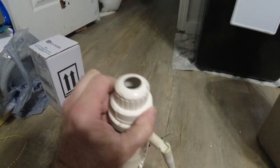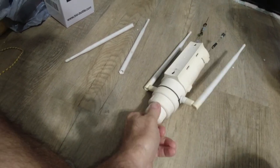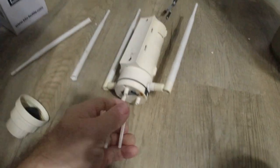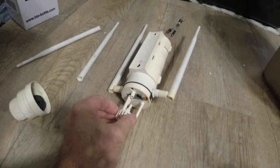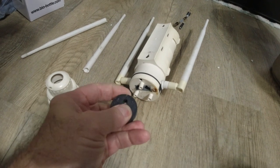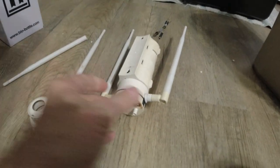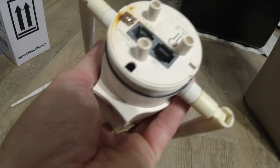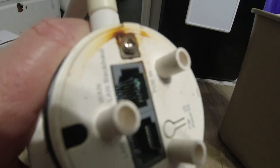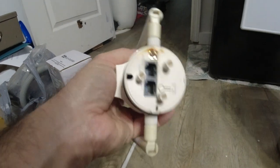I don't think it held up that well. It was hanging upside down, and I went up there, took the ethernet off, and the ethernet connection was all rusted. This thing was in here like this — this was supposed to keep the cable in a spot. The ethernet cable goes through here, through this hole, and water got through. You can see that's rusted. The connectors, the pins, have rust on them. When I initially took this out, there was water coming out of it. Water got inside.